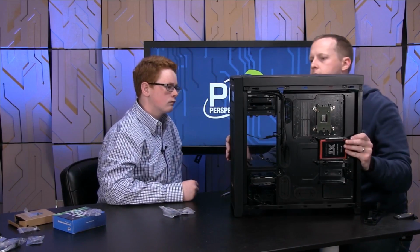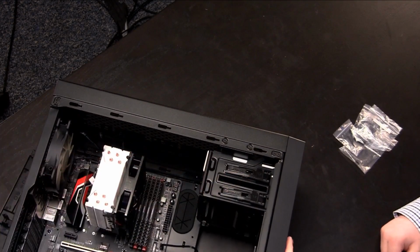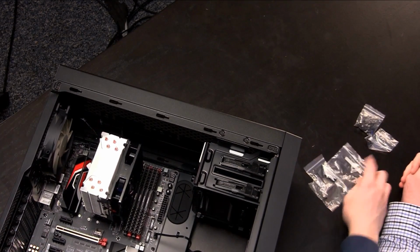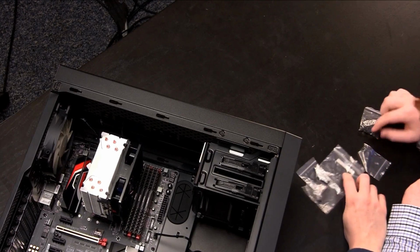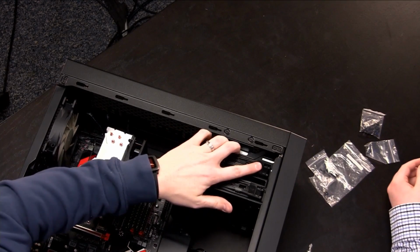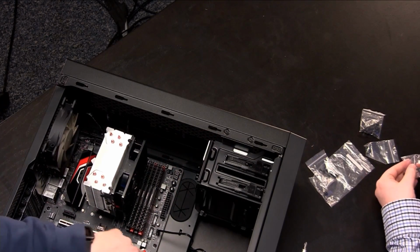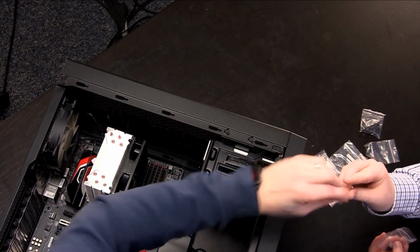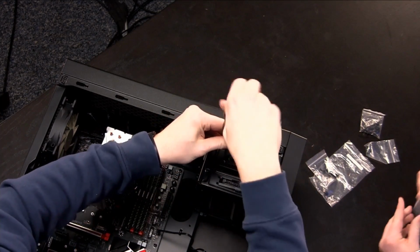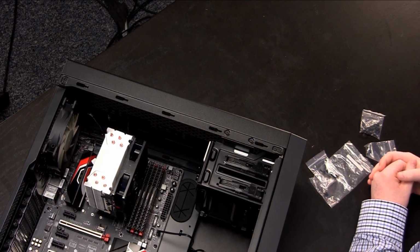You can put a little screw in there. Here, we'll turn it down again this way. So even though you've got these toolless bays, it kind of makes sense with optical drives, especially since they're spinning media, to use one of the smaller screws that we're going to use for the SSDs. Yeah, give me one of those. We'll go ahead and put that into this retention thing here. See that? Put that in there. There we go. Just in case. We don't want that buddy popping out.